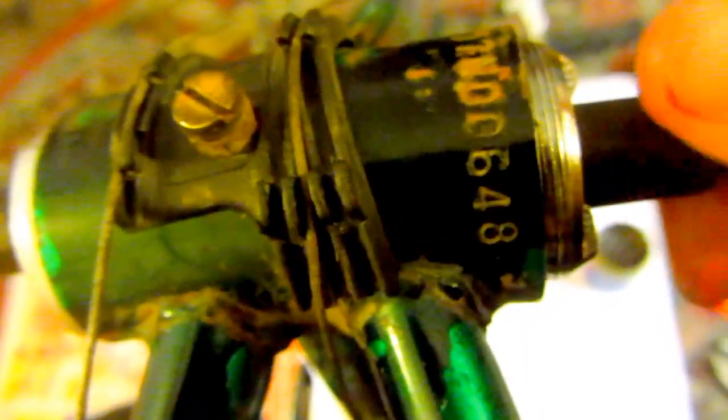And this one rotates to the right. Okay, get the tool and rotate it. I use this tool. It's not the right tool, but you can grab it from this side. Something like this. And you can rotate it. Okay, and rotate until there is no movement. If I unscrew it, there is more movement. Still a little bit. Now it's no movement and it's also freely rotating.